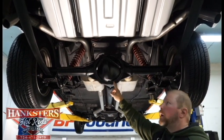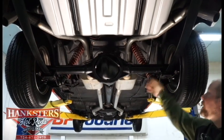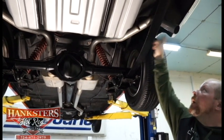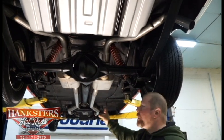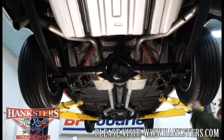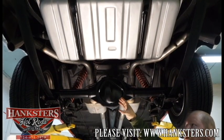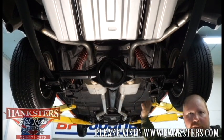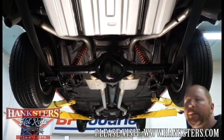This is the 8.2 ring gear as well. Other things you can see from back here: the dual exhaust, the tailpipes running up over the top of the rear and exiting out between the quarter panel and the leaf spring, just as they should. The pipes all the way up to the ceramic-coated headers look to be all-new on this car — real good shape. All the exhaust hangers are intact, with frame mounts, rubber bushings welded to the tailpipes. The Flowmaster dual mufflers are back here, going to give it a nice throaty sound — all-new pipes the whole way up to the ceramic-coated headers.